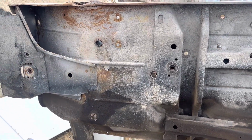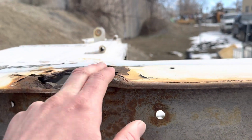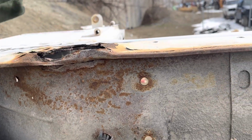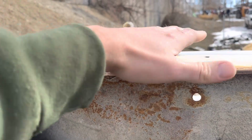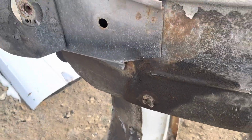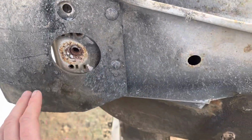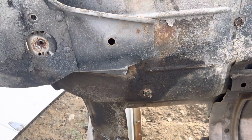If you see other tell-tale signs of rust, like this tub, for example, usually this would indicate that I'm going to be messing with torque pockets. Ironically, the rust that it has is on both sides, and it's completely blown out, both of these corners here and here. And so I would have expected to see bad torque pockets, but the torque pockets on this one are actually not bad at all. And surprisingly, none of the bolts broke, which even on a clean tub, bolts will break on these guys.